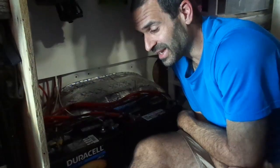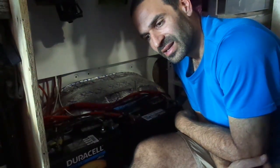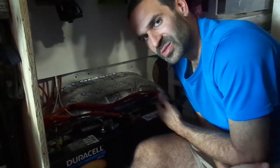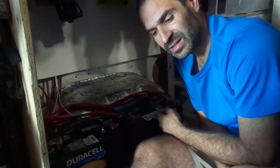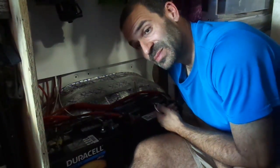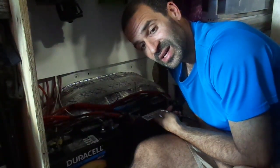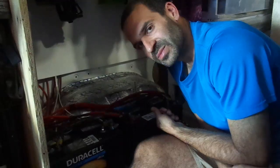There it is folks — I got a new battery and I've just doubled our amp hours to 230 amp hours. Now we can be in the shade all afternoon, maybe watch a movie, and not worry about running out of juice, because we had an underpowered battery system for our 320 watts of solar power. I'll put a link here so you can see me building this system out on my other channel, where I shared the full build-out of this solar system in the Sprinter.